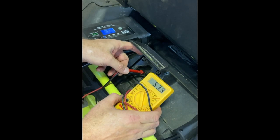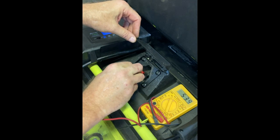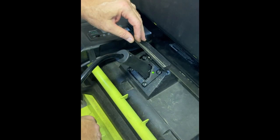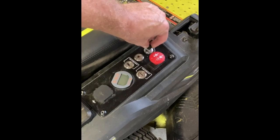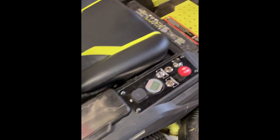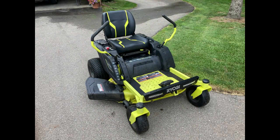I just want to double-check — make sure I've got 54 volts here and it's positive, so the positive lead is on the left-hand side as we're looking here, red. We'll take our rewired connector plug from the charger and go ahead and plug that in. And now the green LED light goes on, which means the mower thinks it's got a charger plugged into it and it shouldn't move. When we come over to the key and turn it on, nothing happens. Interestingly, when I unplug the plug, the green light is off — and now the power went on. Thanks for watching my video; I hope it was helpful for you.